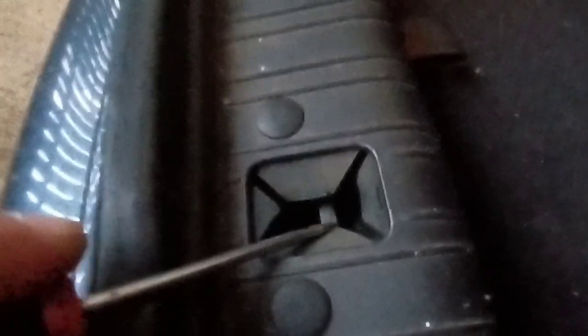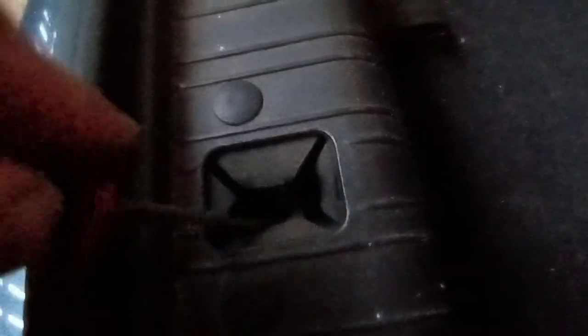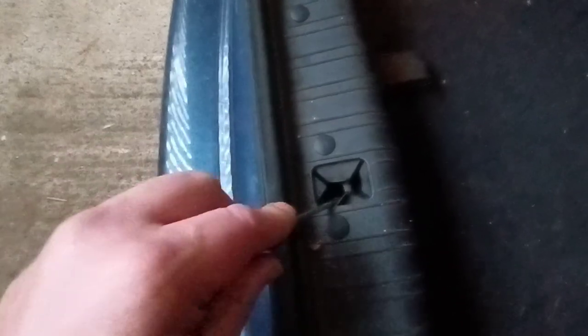That's emptier than an empty thing — let's just grab a screwdriver. Hopefully it's that simple. I think if we just clean and try to get down in there... yeah, you can't see, big hands are in the way. This is the part I'm on about — just the bit where the boot locks down into. It's obviously just dirty, so we'll give that a clean up. Going to get some more penetrating fluid or electrical contact cleaner, and I think we should have the problem solved. I'll get some more fluid and then I'll be back.